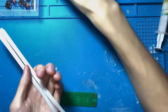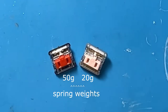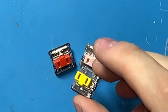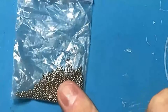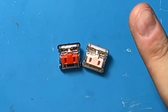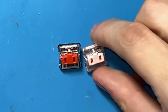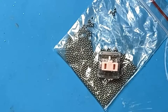Now that we just have this, set it aside and talk about key switches. I've recommended Reds and Pinks before, and also Yellows — but I don't really stand by Yellows anymore because they're kind of heavy, about the same weight as uncut pads, so I don't see that as an improvement. What we do to these switches is shove ball bearings into them — these are 1.2mm ball bearings. You can also get 1.3mm if you want some over-travel. It feels closer to how a rubber dome works, where you press all the way down to get the button press. By reducing the travel distance, the bottom-out will be closer to the actuation point, making them feel way better.